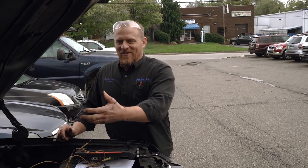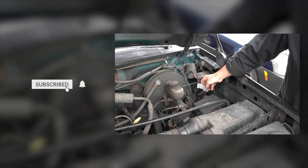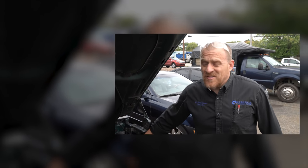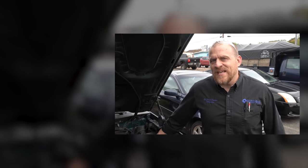Final thought: maybe don't be a parts changer. Take what you learn on a 1993 Ford Bronco F-150 and you can apply it to everything out in the field. One last comment — I know some of you are going to question it. No, we are not leaving the module like this. Once the owner is told what to do, we're not just going to put a pickup in and leave the module sitting loose — it needs to be remounted for its heat sink.